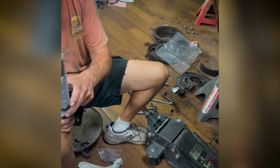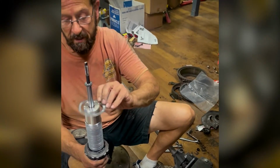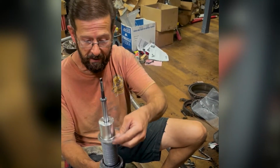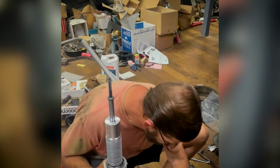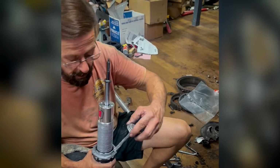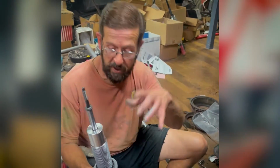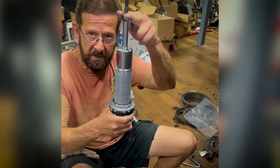What are those bearings? This is called a thrust bearing kit. And that just sandwiches in between. It rides on these little tiny bearings here, and it gives you a much easier time adjusting your ride height with a lot less backlash. The spring sits on top of there, and now you can set your ride height evenly, and we just put a tiny little bit more on here to give it better ease of adjusting and not bind up on you. And after that, we just go with the coil spring on top? We put the coil spring on top of this, we put our bushings down here, load it up inside, and connect this to the lower control arm.